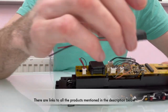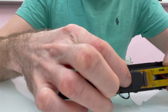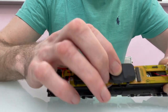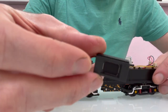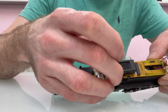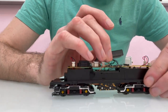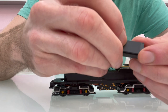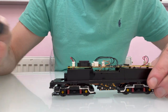I'll have to move some wires out of the way, but it will fit there - it's narrow enough to clear the body. So that's the double iPhone mini; I think that's a good option. This one will definitely fit as well, and could possibly be used in conjunction with the existing speaker, though I'm not sure yet - I probably need to try a few. These speakers can be made a little bit thinner by taking the foam pads off them, which just peel off like a sticker if you get your nail underneath.